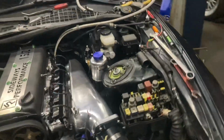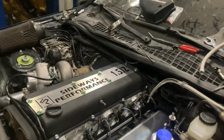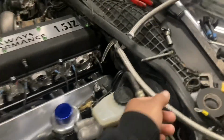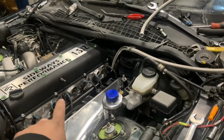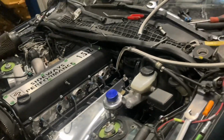So pretty much all we have to do, and it'll probably conclude the majority of this video because this video is already pretty long, is we're gonna go ahead and get our fuel line hooked up in our 10AN. We need to cut this PTFE line to length, put it in. We still need to put a cam sensor in the rear, even though our harness and the Infinity only run this cam sensor. We will have to put one in there as a dummy sensor. I've got to finish wiring up the boost controller because we had to cut that off to do that. Back here real quick, I'll show you what's going on.